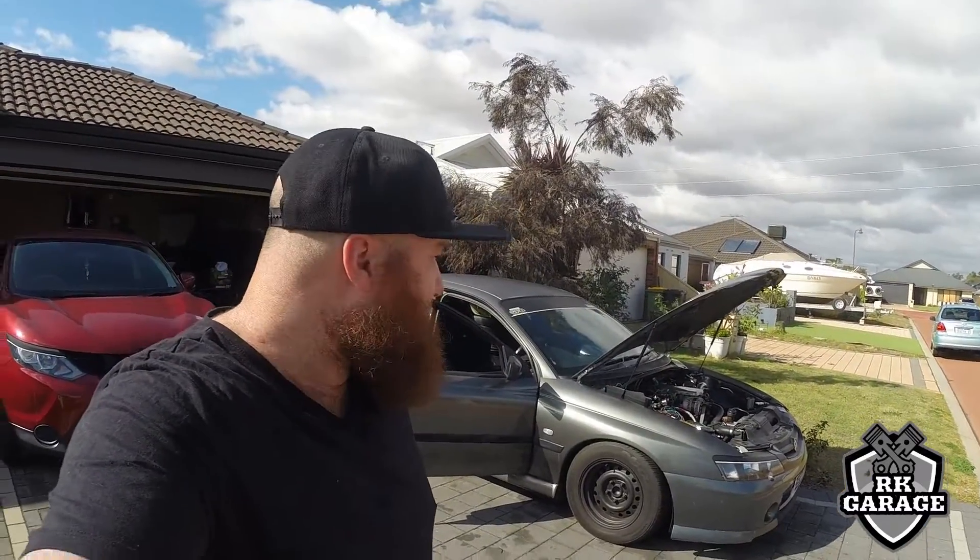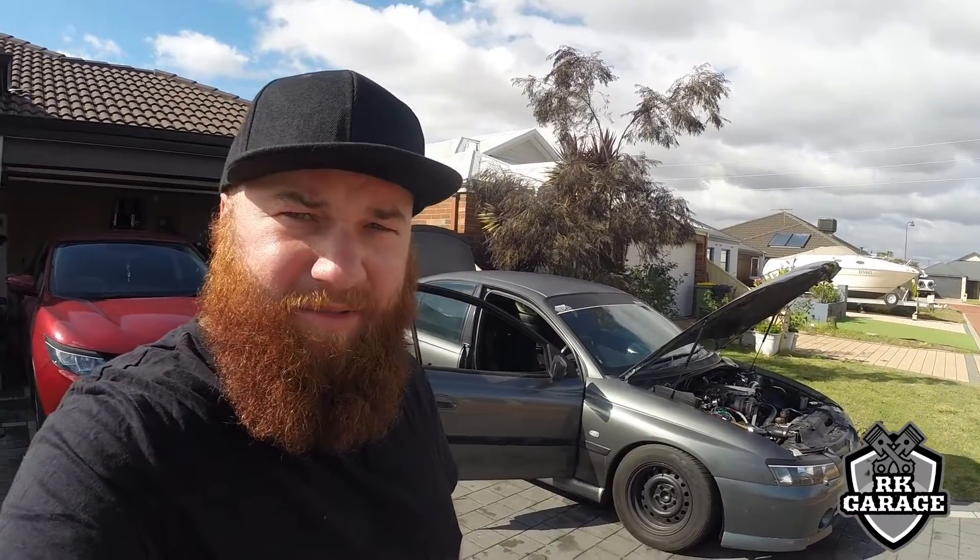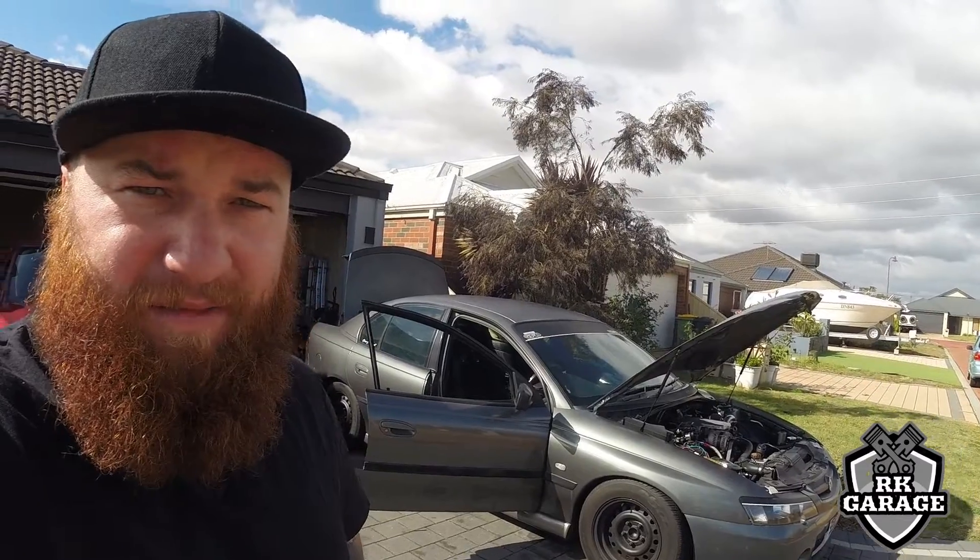The aeroplanes are gone, now you guys can hear me. Had some issues getting it started — it was just the crank table with the fuel enrichment. I just had to add 10% and then she fired right up. It took me a while to figure that out, but it's all sorted now. So now I'm going to start it up and set the base timing.